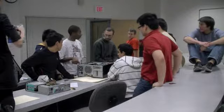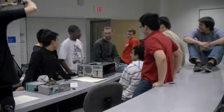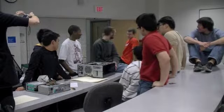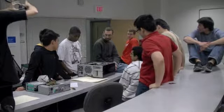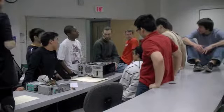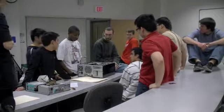Was 80+ certified? Yes. Good to know. If only it worked for 4 years. That's also one that came with his case. Yep. They're not always bad. But I think we diagnosed that by swapping parts, right? Yep. I swapped these from one of these power supplies and it turned on, so it was a power supply.